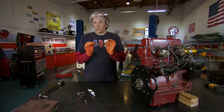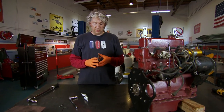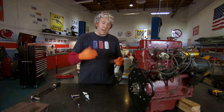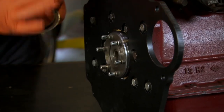We're finally at the stage where we can attach this — this is what all this work has been about. This is a Viton oil seal, which is basically a seal that can handle much higher working temperatures. You can see it's also got a little spring inside there which helps keep the rubber in contact with the slip ring we put into position. It's also been modified — normally there'd be a little shoulder and you push it into a crankcase, but they've also drilled some holes here so it can be bolted into position. To make sure it absolutely keeps all the oil in, I need to put a whole load of silicone sealant around the outside, and also in these areas here where there'd be a possibility of some oil leaking out.